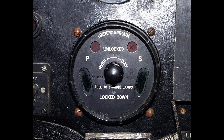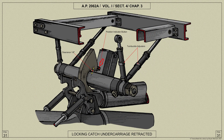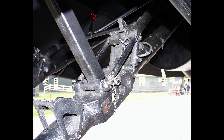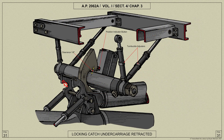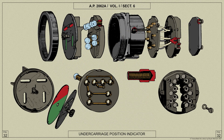The indicator is operated by the undercarriage up and down switches. The two up switches on the up catches in each nacelle, which are used as on/off switches, are connected in parallel and remain in the on position until the undercarriage is locked up. Red lights will therefore show until both latches on each undercarriage unit have been locked. The two down switches, which are fitted in the locking mechanism, are used as two-way switches and are connected in series, ensuring that the green lights for each undercarriage unit cannot indicate until both switches have been operated.